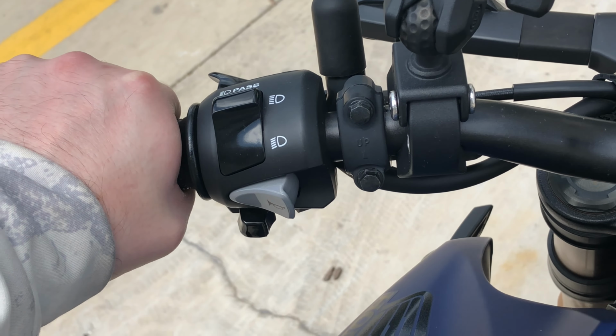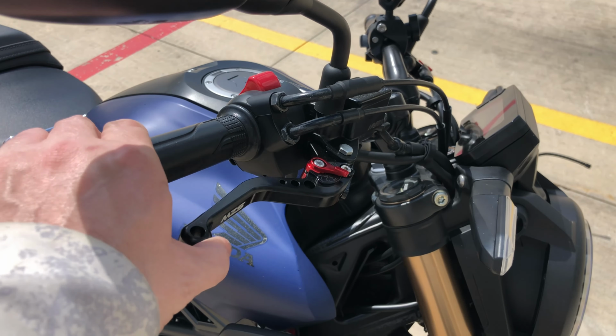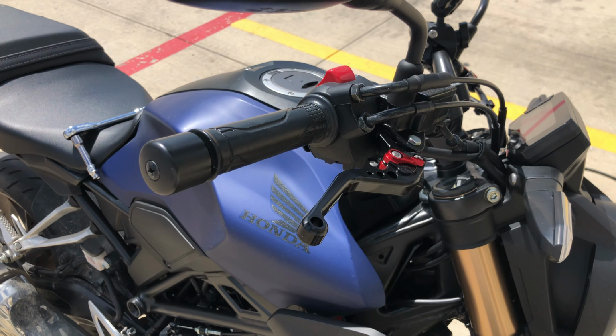Okay, so on the brake side, because of the throttle mechanism and the brakes here, the brake line, I couldn't get this much lower. This was kind of locking up. That hose only bends so far. Let me zoom out a little so you can get more context. So this is my brake line, and it comes down and goes into the dash, and it only wants to flex so far. So I couldn't go as much of a tip on this as I wanted, but I don't think it's a problem. I didn't feel the need for it to tip as far.